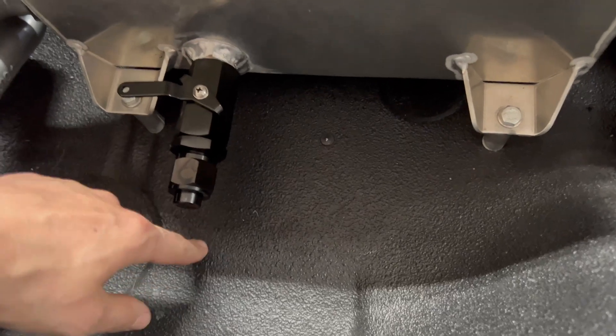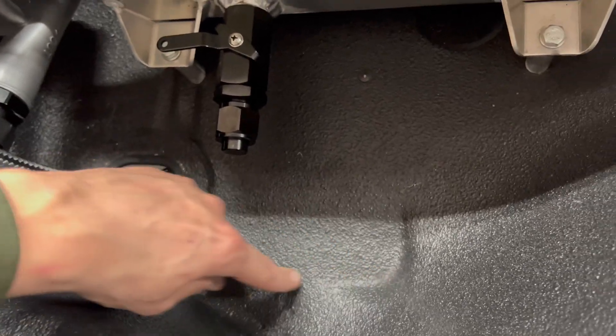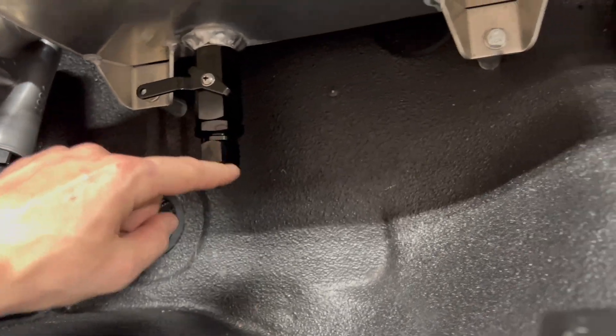Can't really put a 90 here and go through the floor — I mean, we could go through the floor, but right here is where the body line kind of ends. So you have this tray right here. It's going to be kind of a tricky one. We were thinking just keeping the cap on it and running a piece of rubber hose out to this one whenever we need to drain it. But I also don't know how often we're going to have to drain it since we're going to be running ice water. I see people ice them down every pass. If you guys know, comment down below — should we put a hole in the floor or just run a tube every time we need to drain it?